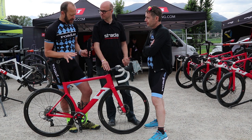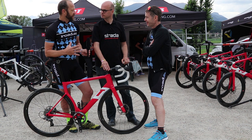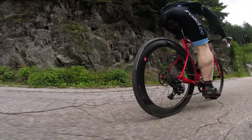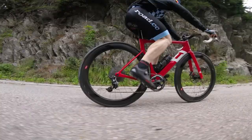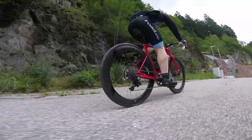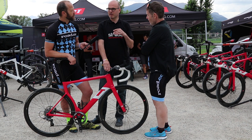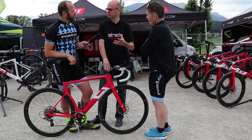We optimized this bike to be aero-efficient with 28 millimeter tires — and that's a measurement made on the actual tire, not necessarily printed on the side. The rim width has an effect on the effective width of the tire, and every tire manufacturer seems to have their own definition of how wide a millimeter is. If you have a wider rim and a 25 millimeter tire is actually 28 millimeters wide, that's great — you get the effective 28 millimeter width with a lighter tire that still weighs the same as any other 25.